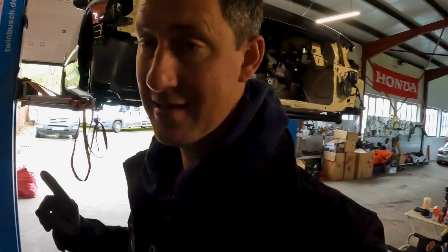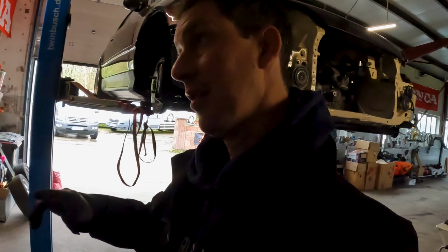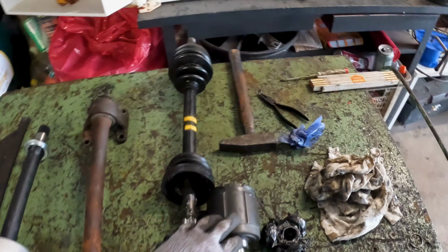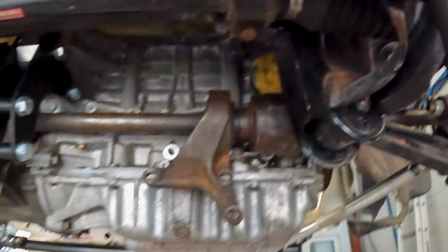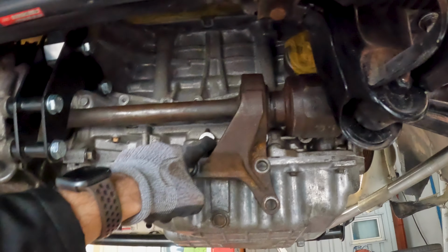So what's up guys? Well, just in between from the drive shafts, which is an absolute mess, and I wish there would be a little bit more information out there. I'm not sure if it's because of the EE8 chassis that I'm having so much trouble, but we currently have the right side drive shaft on the left side. We changed the outside pieces here so they can swap, so this is actually the long one, and then on the passenger side we have the short one. Also we changed the joints on them too. What's currently installed here is from the Integra DC2. As you can see, this fits perfectly. It's almost a little bit too tight, but we cannot connect it to the engine block.